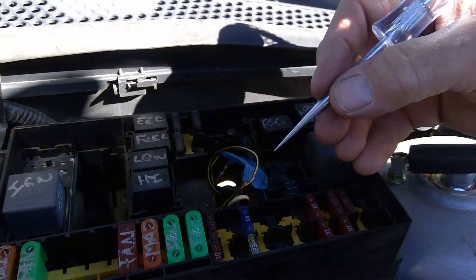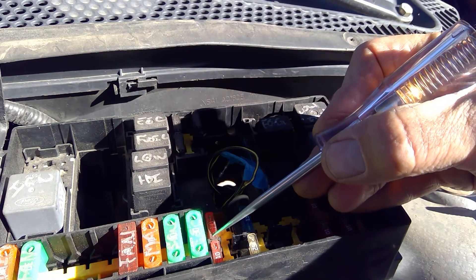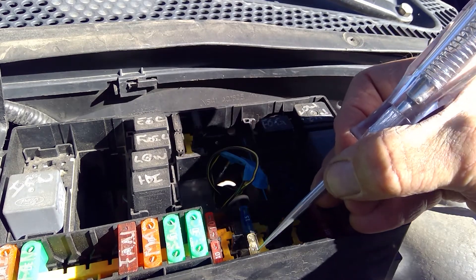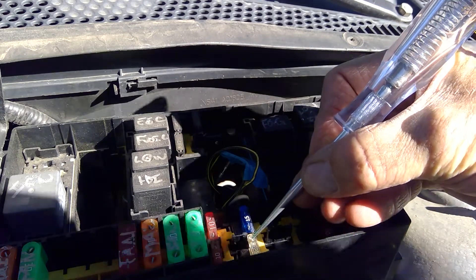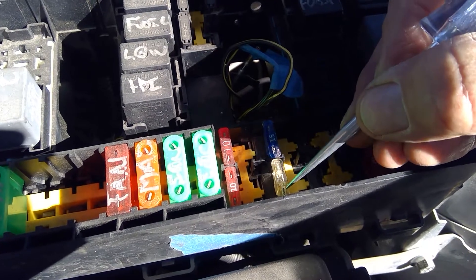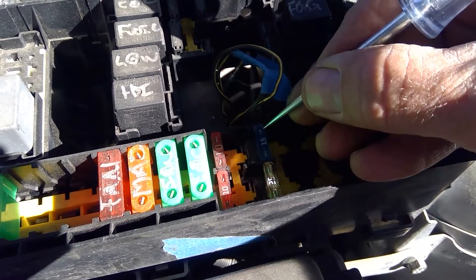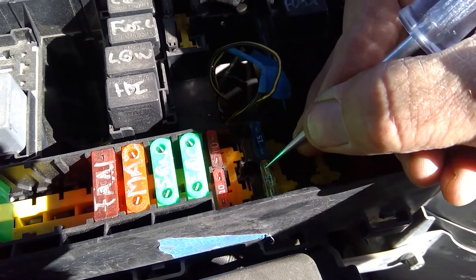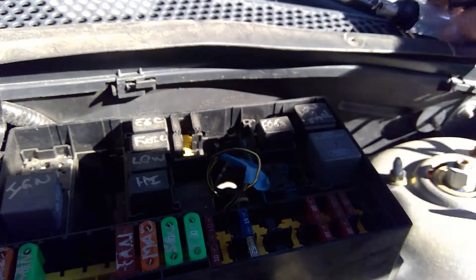As I'm coming back here and checking these smaller fuses, I'm getting voltage on both sides of each one — good, good, good. But this fuse is blown. It only has voltage coming into the fuse; it doesn't have voltage coming out like this one does. In, nothing out. So that fuse is blown, and that makes sense because that's actually on the circuit that I know is at fault.